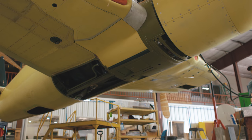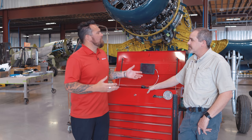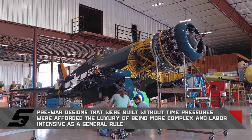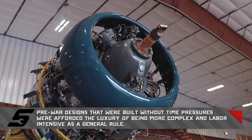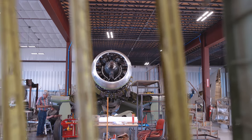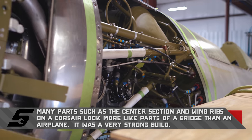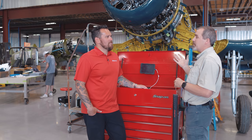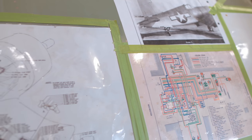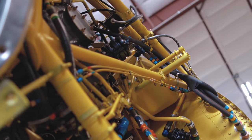Now it looks fast. Not only do we have one, but we have two Corsairs — this one a little further along than the other. What's the story? It was a flying airplane. Two-year restorations are what these normally take, and the engines are overhauled pretty much the same way as they've been since the 40s. The Brewster Corsair came in as a wreck — a major rebuild. The pilot jumped out, it crashed, hit a tree, spun around, and people came over the years and started taking parts out. One guy cut the tail off, the left wing was disintegrated. We've been working on that one seven years, but it's the only one in existence — the only Corsair built by Brewster, and they only built aircraft for about a year. We'll be flying this one next month.